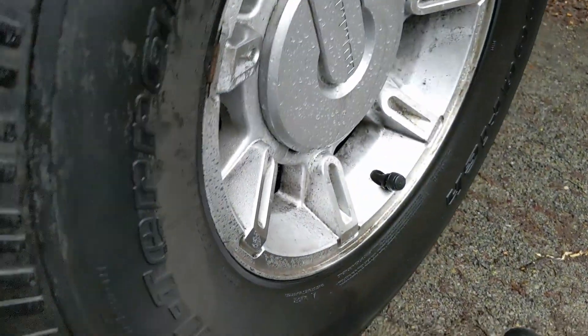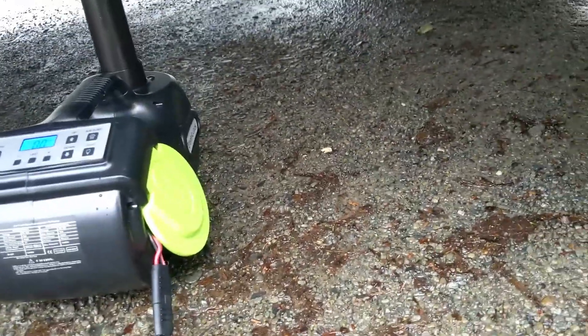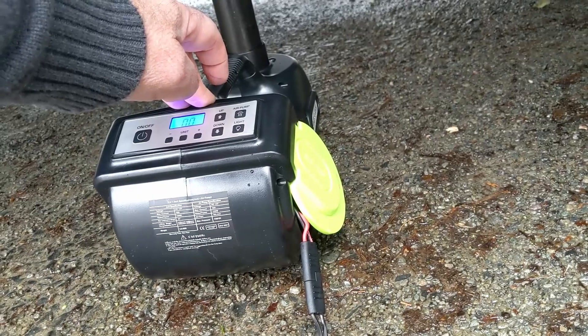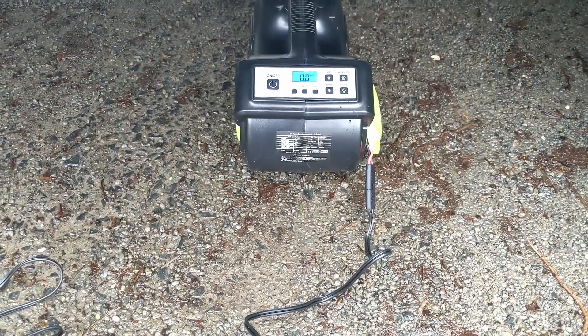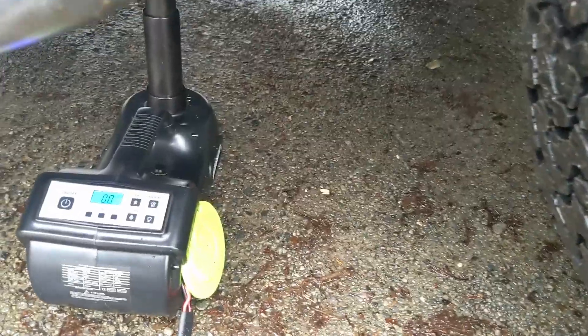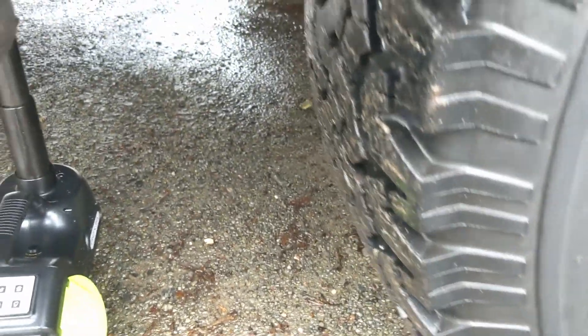We now have a wheel in the air — as a jack it actually works. To get it onto axle stands we'd need to go higher, but there's more range available. It did start to struggle a little at maximum height, but the vehicle is in the air — quite amazing really. If you're on the side of the road and needed to do this, this would be an excellent tool. Even with the extension bar fully wound in simulating a flat tire, we still got enough stroke to lift the wheel off the ground. One important note: these are not very good with sideways movement, so as you lift you'll put some sideways tension on the bar, which may not be ideal.